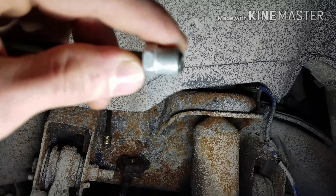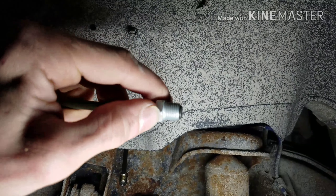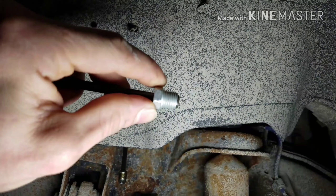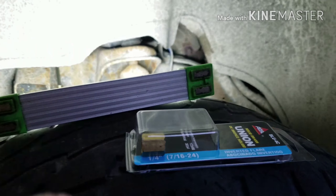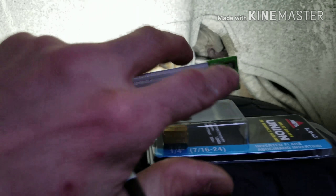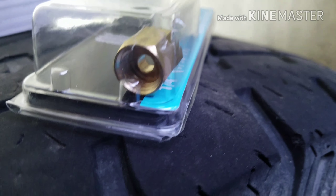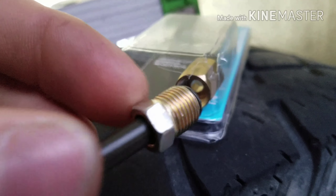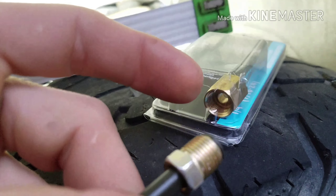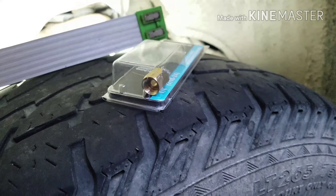This is a half-inch 20-thread fitting — so it's a half-inch fitting with 20 threads. If you need this, just tell them it's half-inch with 20 thread. This adapter is going to connect both of them. You want to make sure you get a fitting that's made to go onto a compression fitting — this is a compression fitting, and as you can see it has a nipple on the inside that's made for a compression fitting. I'm going to jump under the truck and show you how I'm going to put it together down there.